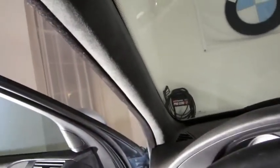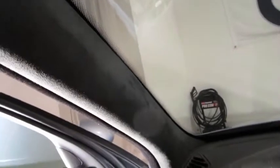We're now going to pull the A-pillar trim pieces off — these are Alcantara since this is an M5. Note that some pre-facelift models may not have the Torx bolts; you may be able to just pull them off. The facelift started September 2000, but this is a February 2000 and it has clips. Use a pry tool or be very careful with a flathead. The black HPS head protection system covers need to pop off first, revealing Torx bits underneath.